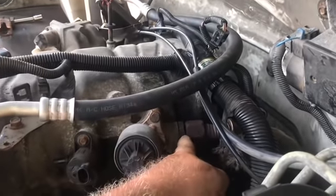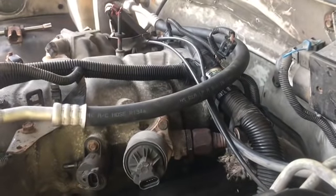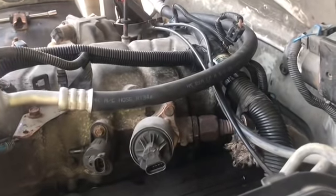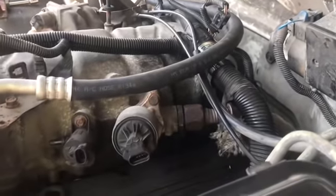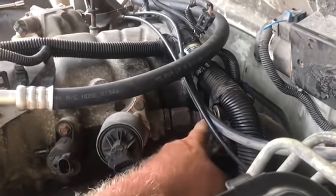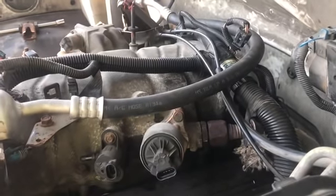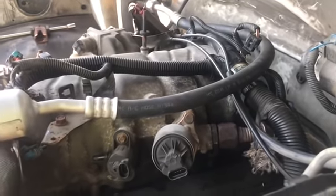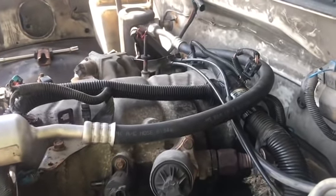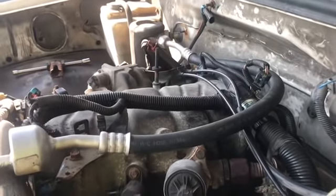I need a wrench here, and it's not a 15/16. It's something just a little bit bigger, like a 1 3/8. I'm sure it's metric. I don't know what the metric equivalent would be. And it's the same size as this. But if you try and turn this, then that thing starts turning, and you'll just twist this metal and ruin that, and you make another broken part. Yikes. Then it'll be really loud under the hood, and there'll be exhaust gas blowing around under here. Then it enters into the cab, and then you're breathing that in.